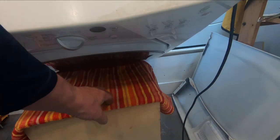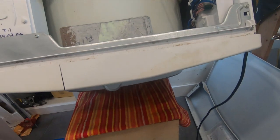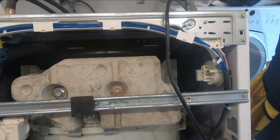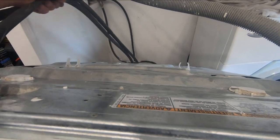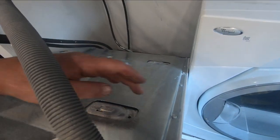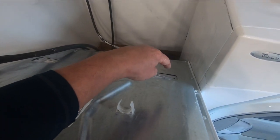I'm going to remove the back. I've tipped this front-loading washing machine out onto a box — a wooden box with a towel on it to protect the front — and I don't need to lay it completely flat, it'll hold right here. There are about 10 little screws to take the back off, and then I'll be able to access that motor control board right about here.